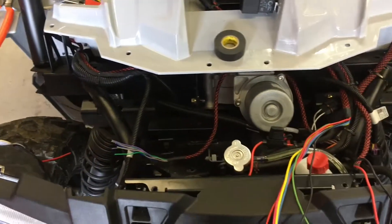I don't plan on putting much rear lighting back here - only two backup lights. I don't need a lot of light behind me. If I add a winch later, it'll go on the right side with the factory match winch switch. All my main switches will be on the left side. For the low beams right now I'm just going to tie in power and ground here and run the low beam headlights until I get my Razor headlights.